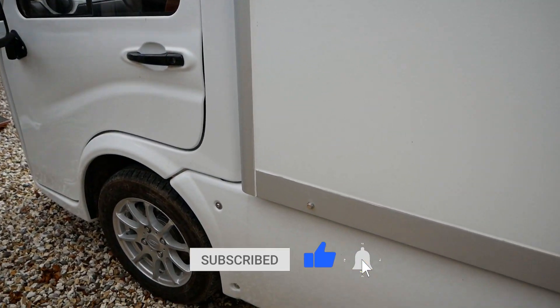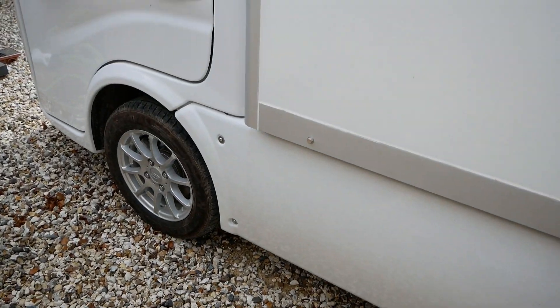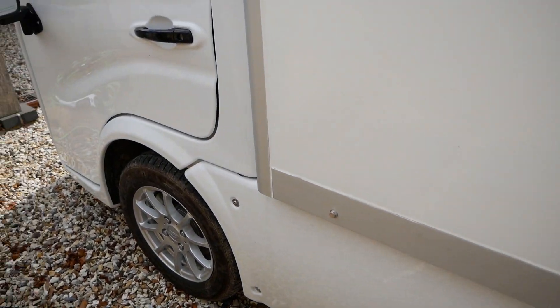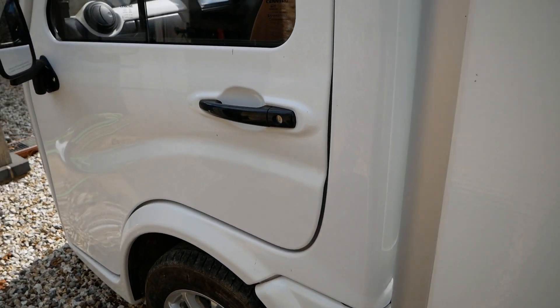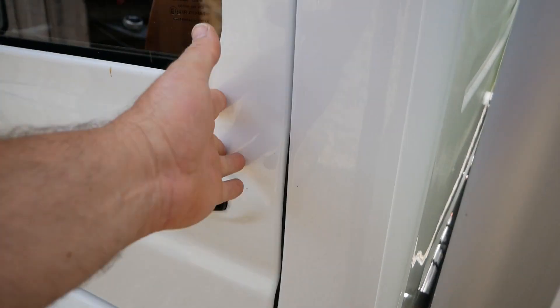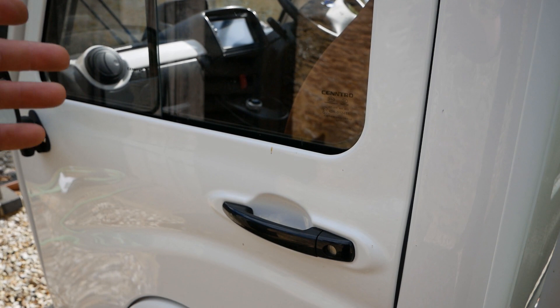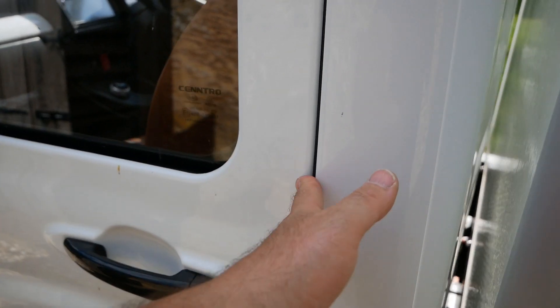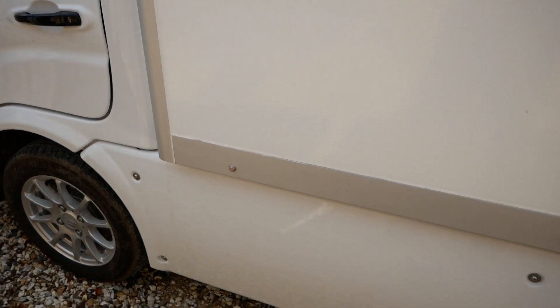In this case I'm on site and I'm actually going to replace the 12 volt battery — put a new one in — because it's gone completely flat a few times and I think the battery has deteriorated. I believe that's because the users haven't been shutting the door properly and leaving the van switched on effectively. If you don't shut the doors properly then the dash stays lit and obviously the 12 volt will drain.